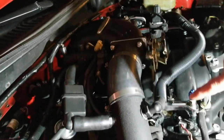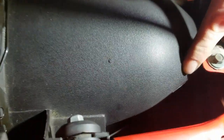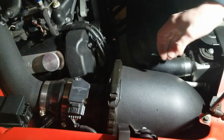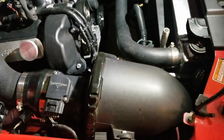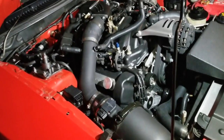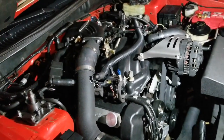And then they gave you Trick Flow's factory pipe, and that runs into a 90 millimeter Lightning mass air, and then we put the heat shield from the factory GT with an aftermarket filter down in there. You can kind of see a little bit of red poking through. Yep. So it's got a high flow dry filter in there. Okay. And that pulls from the factory location of the wheel well, so it feeds up into there, keeps some of the heat out. Yeah. That's always been my biggest thing, keeping the engine bay heat away from the intake. So I like how it's double purpose. It does that, plus it also keeps the engine bay stealthy. If somebody didn't really know, they would just see, oh man, he just put money into making the motor look nicer, put some valve covers on it, and cleaned it up. But it's got a lot to it, and it looks clean at the same time.